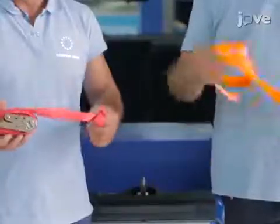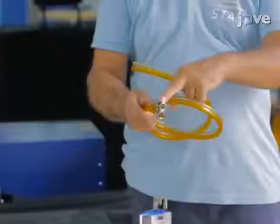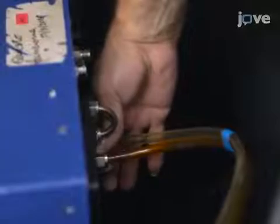If the PEMS must be installed in the cabin, secure it with straps to the car. Install a vent to the outside for exhaust gases and condensates vented by the PEMS.